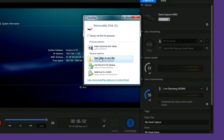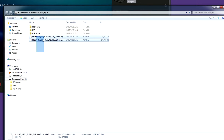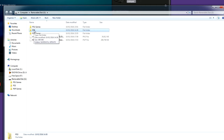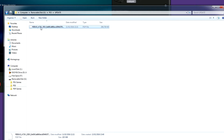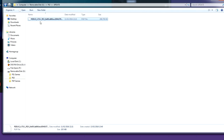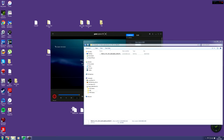So you just want to open the files. As you can see, my memory stick already has a few things in it. If you followed from my last video, you should only have a PS3 folder - click on that and you've got an update folder as well. You might or might not have a file in there already. As you can see, I've already got the firmware update dropped into the memory stick. You can download that from the description.